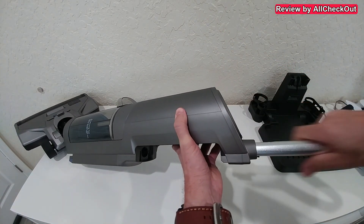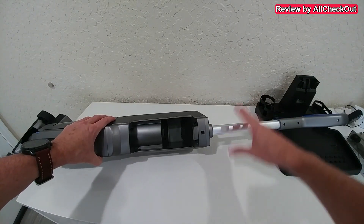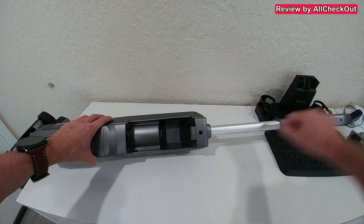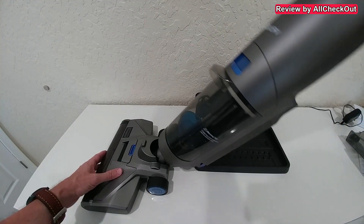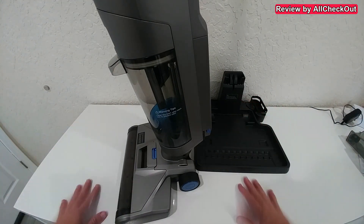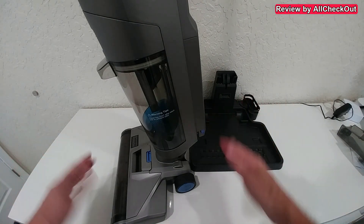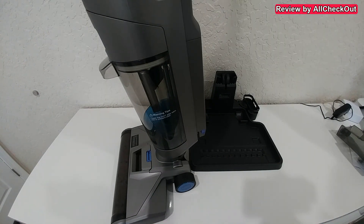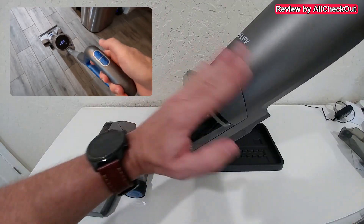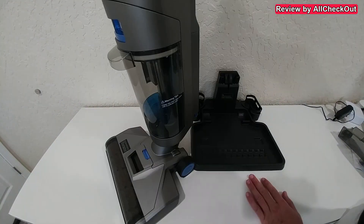Now we mount the last part — push the handle inside and push it down until you hear a clicking sound, sometimes two clicks. If you ever need to release the handle, push inside with a screwdriver and pull the handle out. The vacuum has two positions: an upright position where it has a safe stand and is always on pause — great for when you need to move something — and then tilted for cleaning. Make sure you're not tilting it more than 60 degrees to avoid water spills.